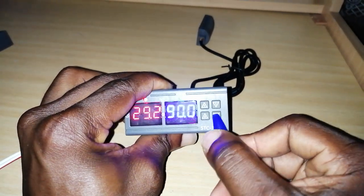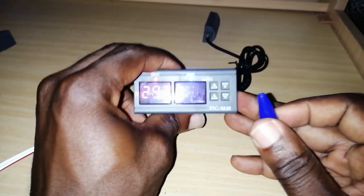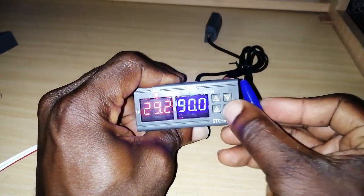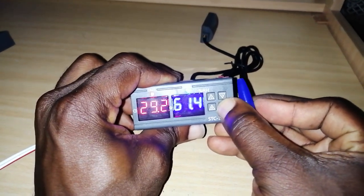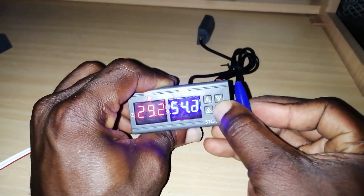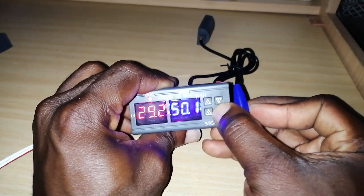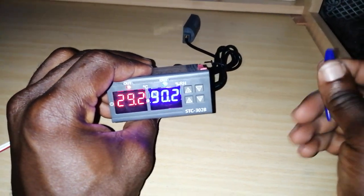Two-up will set the lower humidity to 50. I'll hold it, and when it's blinking I'll reduce it to 50. Remember the trick: if you're not fast about adjusting and the blinking stops, you have to do it all over — but it's pretty easy. Once it stops blinking, it's saved.